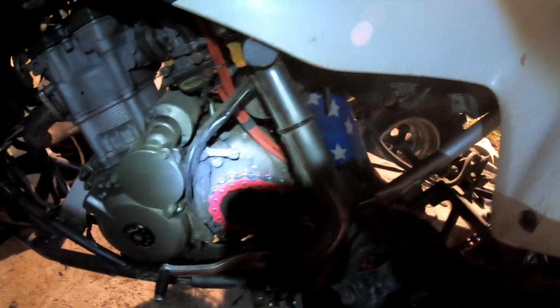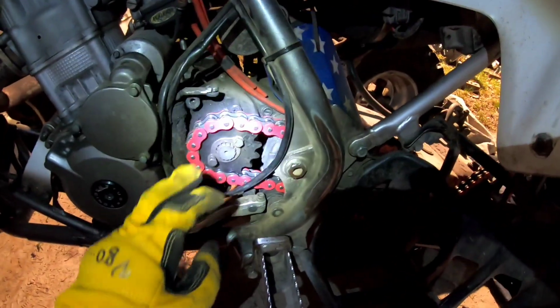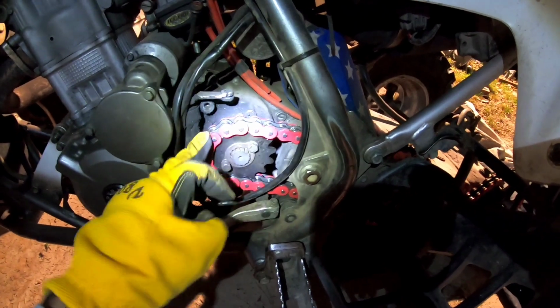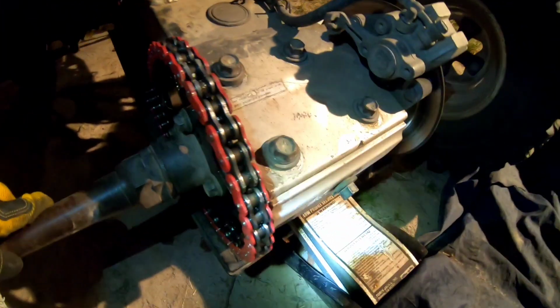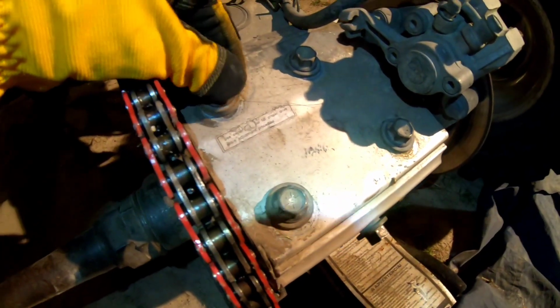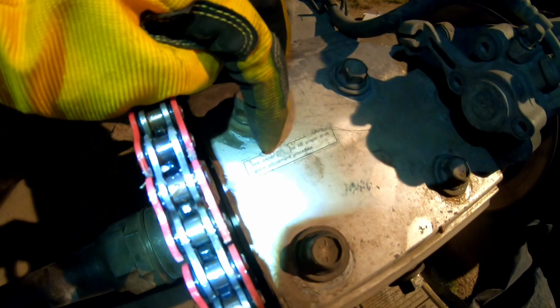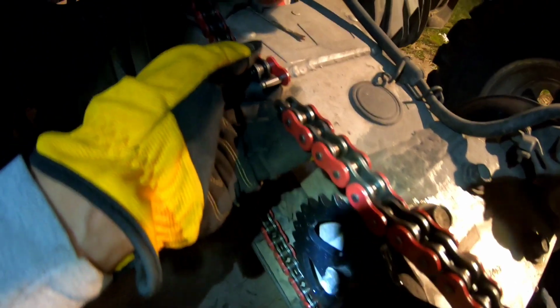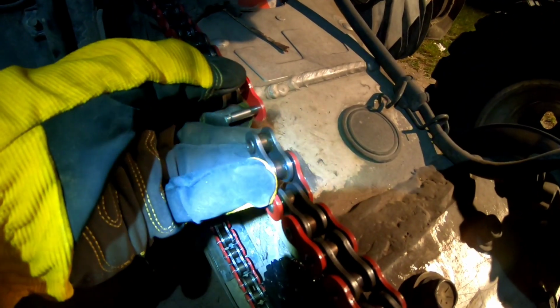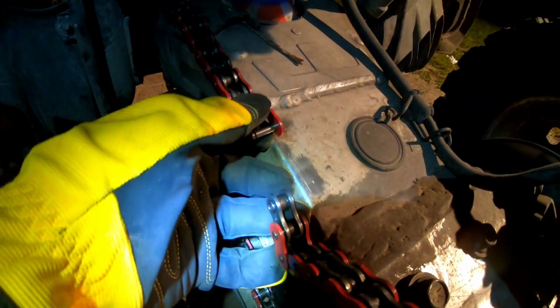However, you guys, listen. I got the front sprocket on, 15T. Now, for some reason, there is a massive struggle, and I have the rear carrier pushed all the way forward. It's pushed as far forward as possible. If you look there, you can see the 4 bolts that you have to loosen, and you can see how it has slid forward. It's as far as it'll go. But you guys, this chain is not the right length. It's not right.